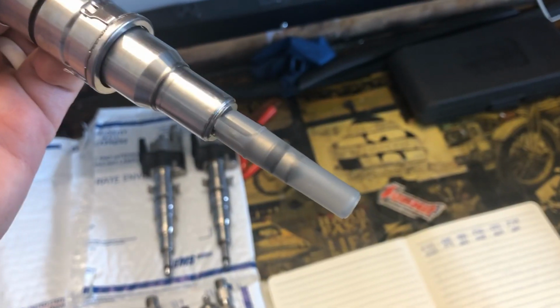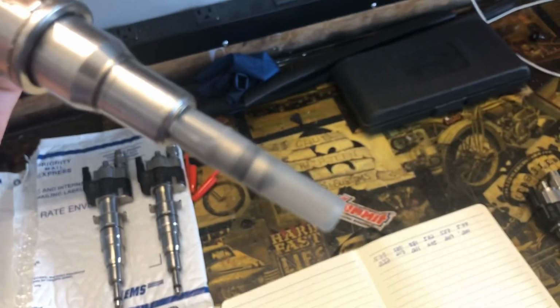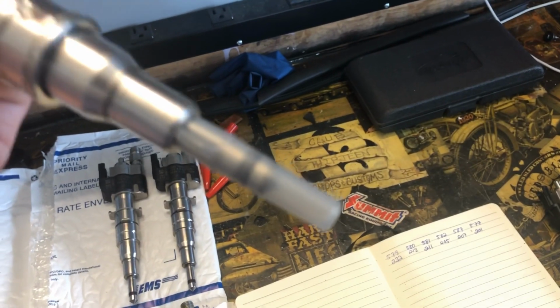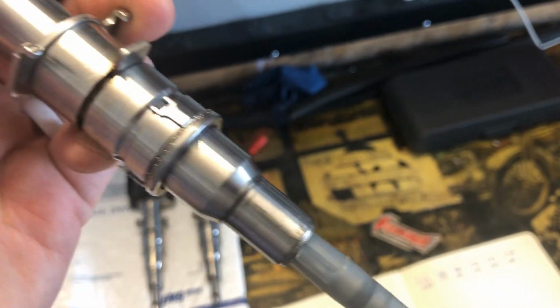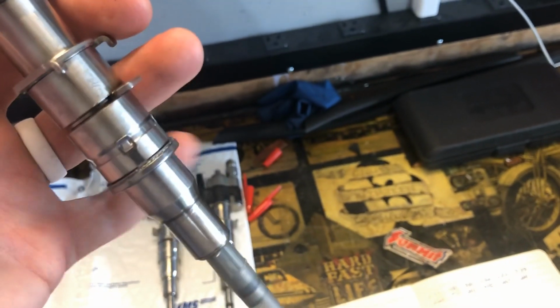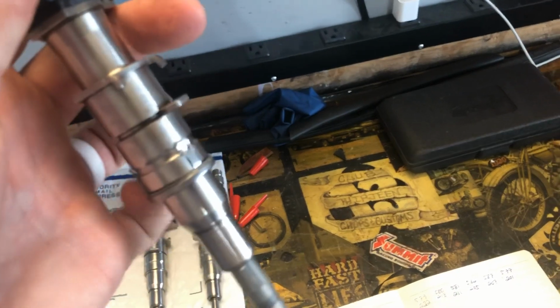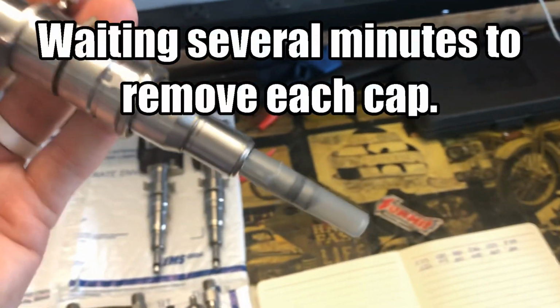Little pen cap trick for the new ones, just making sure that plastic gasket or ring, whatever you want to call it, seal, is compressed so it has the ability to expand once it's down inside. And also we replaced the decoupler rings. It doesn't come with these, so I got these new ones. I'll put links in the description. Pop this off, move the cap over to the next one, and we'll stick this in.